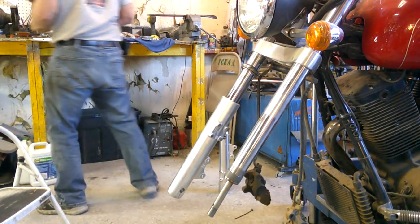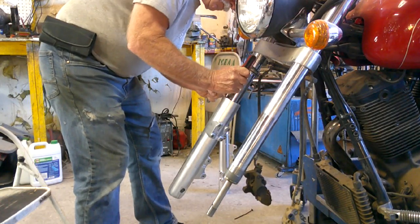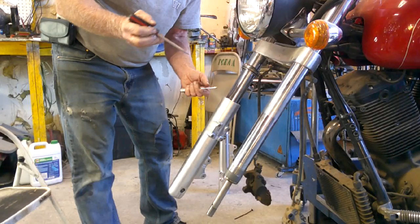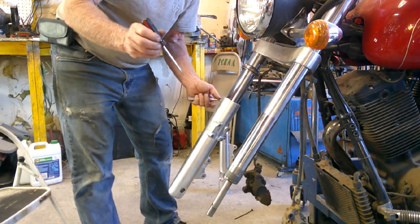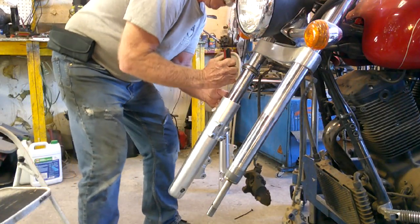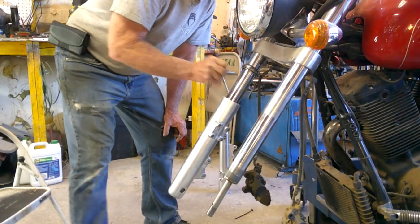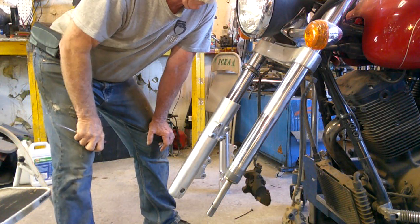Grabber. Be careful putting the snap ring in. A screwdriver is a better tool than a punch, but just be real careful, because if you slip off it, you can tear the seal. Ask me how I know. Okay. And just visually look at it, you'll be able to tell if that snap ring is in on the way. It'll fit in the recess of that groove.